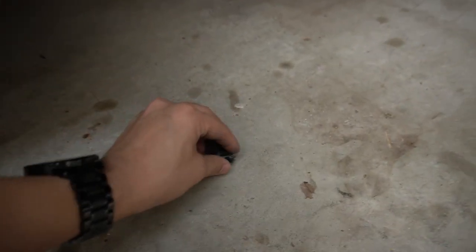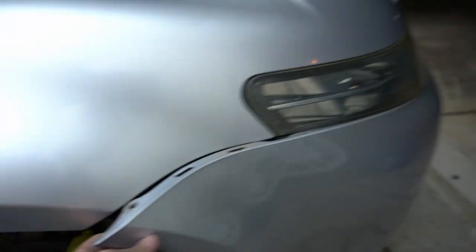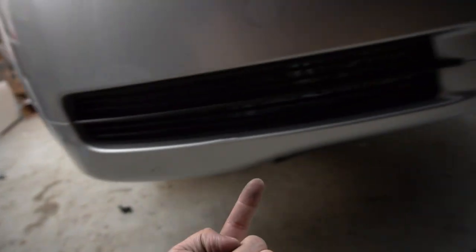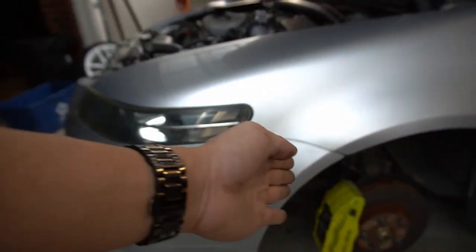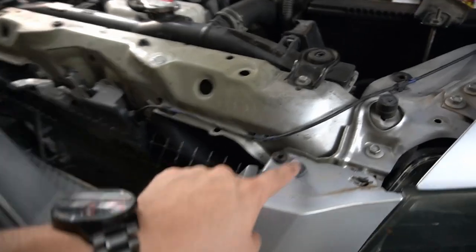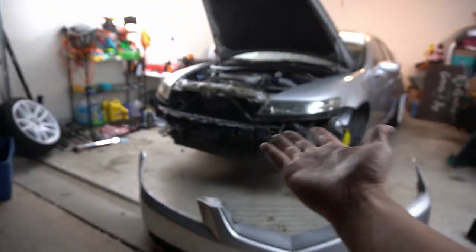These are the clips that are attached right there and right there, and inside the actual liner itself there's a little spot right up there where a screw was. I unscrewed that and this pretty much starts to pop out easy. There used to be a whole bunch of clips running along underneath the car but I already took this bumper off before so they're not there anymore, which saves me some time. I have to do the same thing on the other side, get these clips here, and pretty much the bumper comes off — and it comes right off, boom.